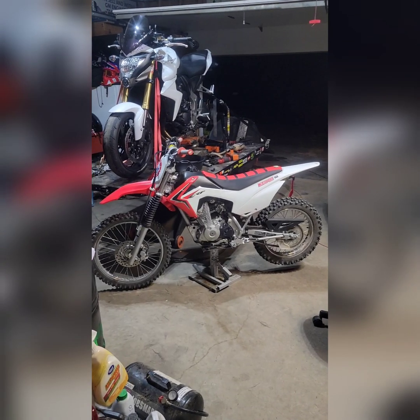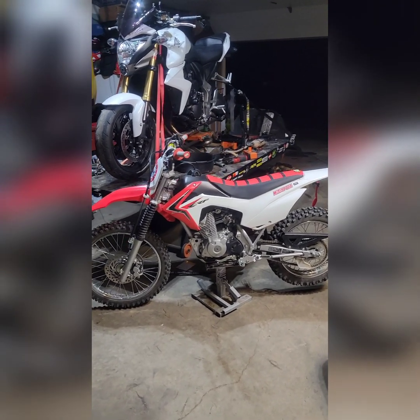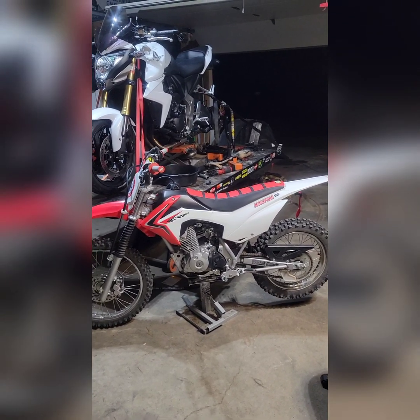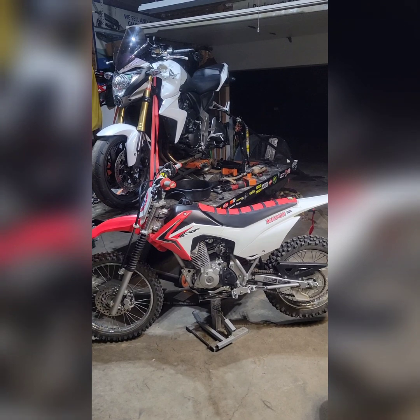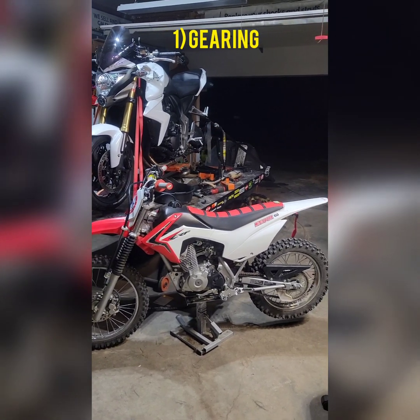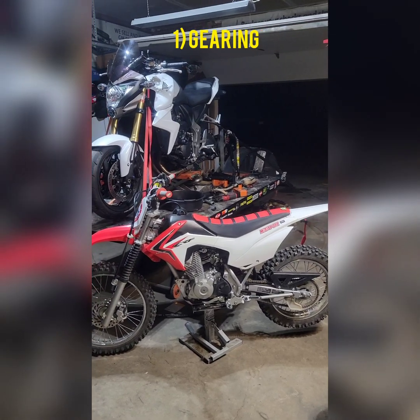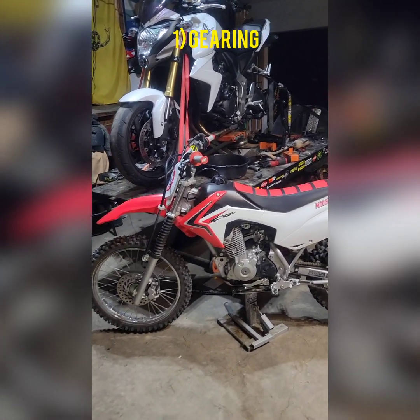Everybody, thanks for watching. This kind of concludes the video for the most part, but just to recap, a couple things you can go over or replace on the bike if you're looking to make a little bit more power or just make the bike more user-friendly for what you're doing. You can always change out the sprockets. Of course, factory is a 13 and 49. You can go to a 46 rear. That definitely helps things out.